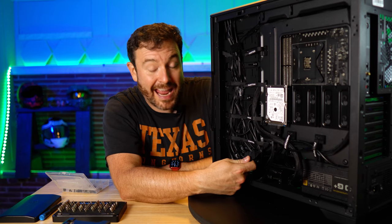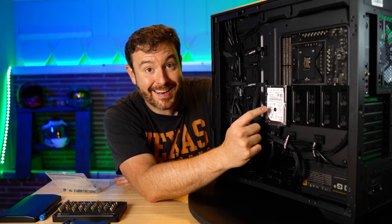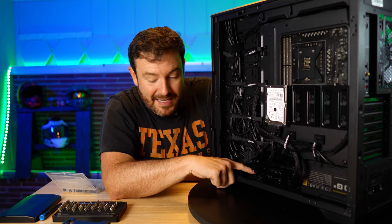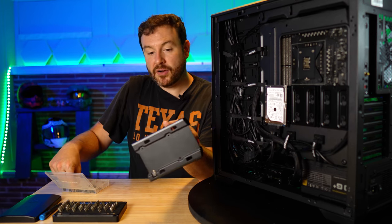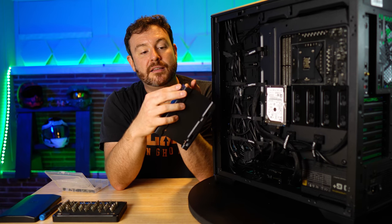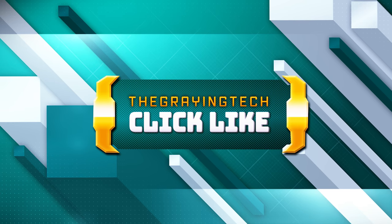In order to get the power cable properly connected to both the RGB, the hard drive down in the bottom, and this hard drive, I did have to move this over yet another cage. But you can see our trunk is in place. This down here is not the prettiest, but the hard drive's in place — I wasn't able to add on the second drive bay. Last thing I want to call out: because these have rubber mounts, there's a different kind of screw that is used — it sits right there in the rubber mount and then extends into the drive itself. These are the little things that can occur when you're trying to build.